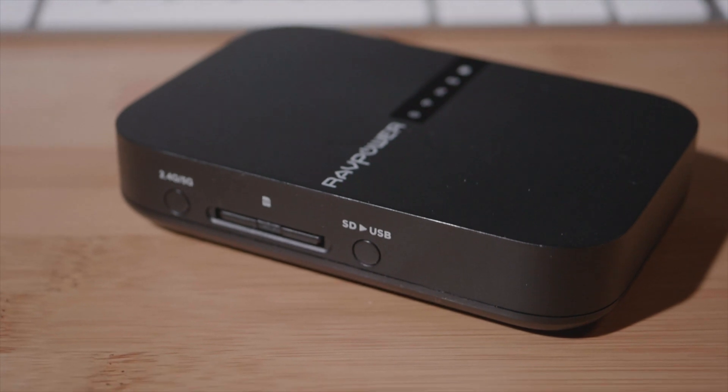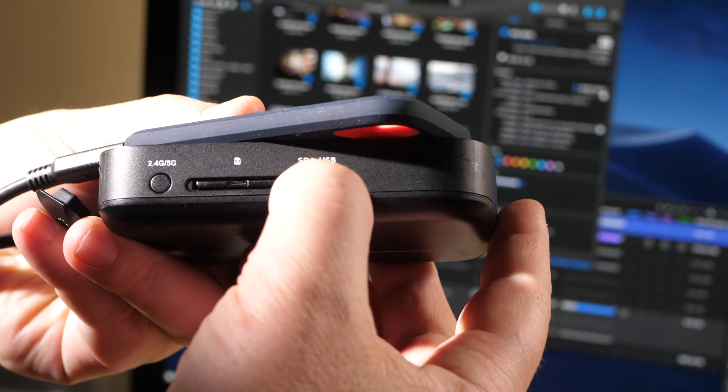Let's move on to the FileHub WD-009. The Wi-Fi is the same as on the WD-007, but we get much better copying performance — better than the WD-03. I did the copy from the SD card to the SSD in right around two minutes. It's worth noting that the OneTouch backup for SD to USB takes a few seconds less than a manual copy-paste every single time. This feature is not on the oldest FileHub, nor is it on the Kingston device. The extra time taken when manually copying is while the device processes two empty directories; the OneTouch system does a much better job of recognizing they're empty and skips them.